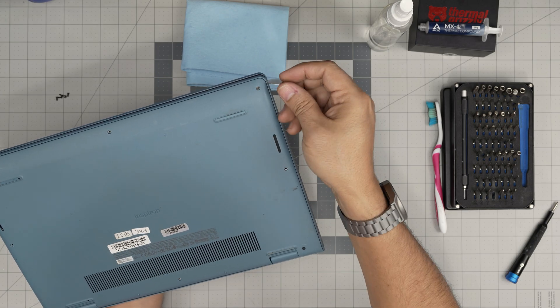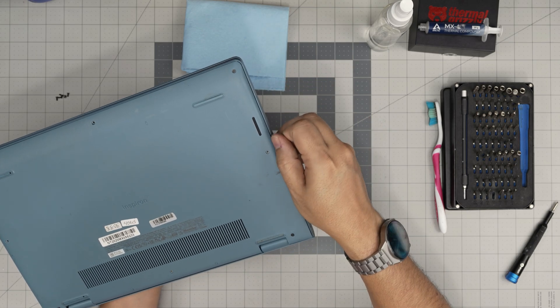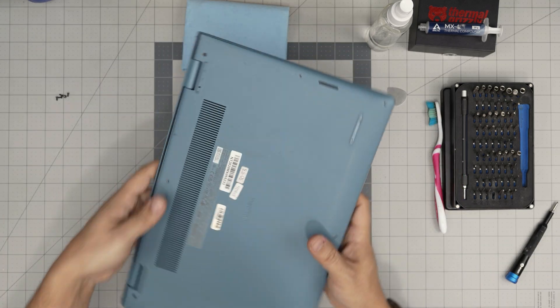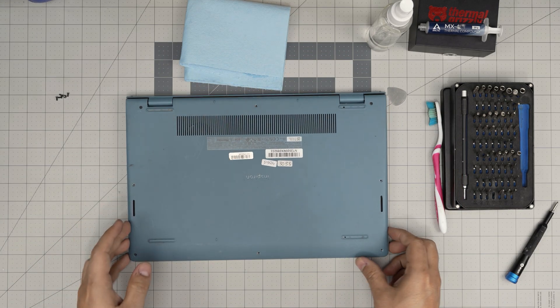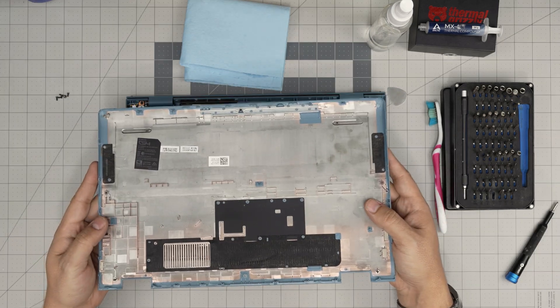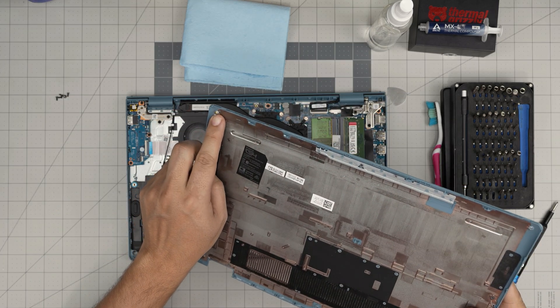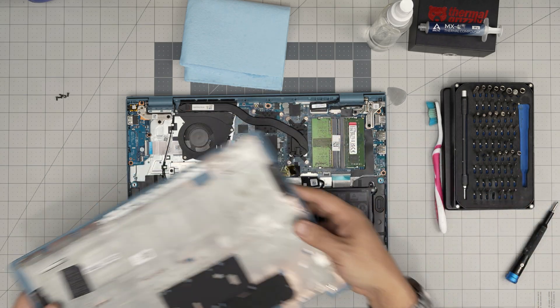Remove your screw — this one had super glue so I'm not touching it anymore. Once you've worked the front and sides, all you need to do is grab it from the corners, lift it up, wiggle it around, and it will get released. I can see they put an epoxy or super glue type adhesive in here — don't do that.